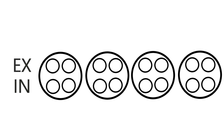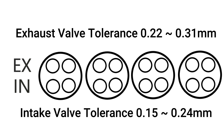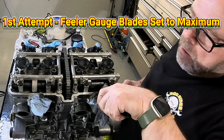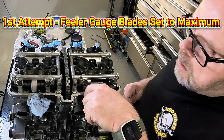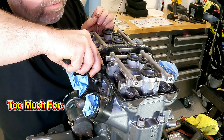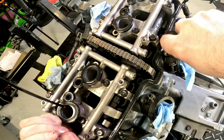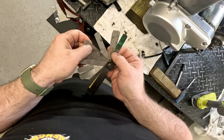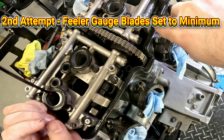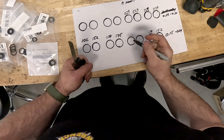My bike has a tolerance on the intake valve of 0.15 to 0.24 millimeters. The exhaust has a larger gap at 0.22 to 0.31 millimeters. I start with the largest of these two numbers on the feeler gauge and insert — or try to insert — the gauge between the camshaft lobe and the valve bucket. The bucket is this hardened steel cover over the valve itself. On this little 600cc engine, I was actually able to move the valve down with the feeler gauge, which will throw out my reading, so I need to be sure I'm not applying too much force. Since the valves all appear to be tighter than the maximum gap, I then reset with my feeler blades to the minimum gap allowed for the respective intake or exhaust valve. If this blade slides in with relative ease, then the clearance on that valve is good.